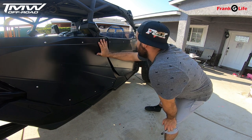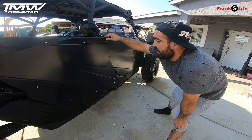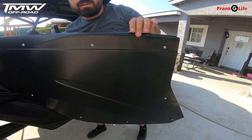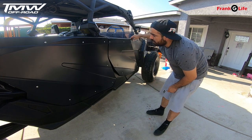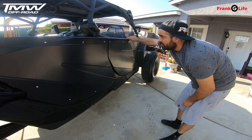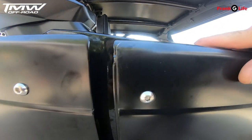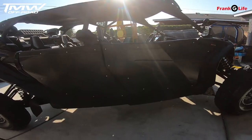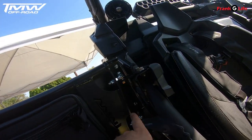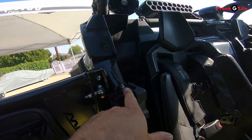So we're checking the alignment and the clearance of the doors. The doors are perfectly aligned up here. The caster is a little off — we'll get to that in a little bit. Let's check the range of movement. These doors do not rub anywhere. Check the rear — they're not rubbing, they're stopping with the brackets like they're supposed to. And now we'll do the front — we've got to make sure that the door does not hit the rear door. It's perfect. When you open the front door, make sure it doesn't hit the rear door, which it doesn't. So these doors are just about perfect. We're going to go ahead and move on to putting on the latches — just double check that these are all nice and tight. Torque them down. These heim bolts though — do not torque them down; we still have an adjustment after the latches are installed.